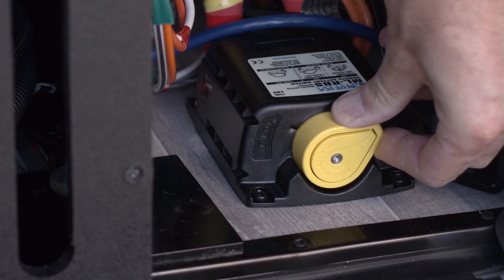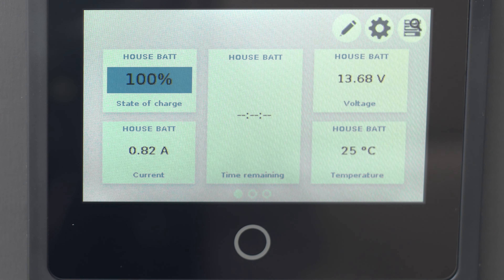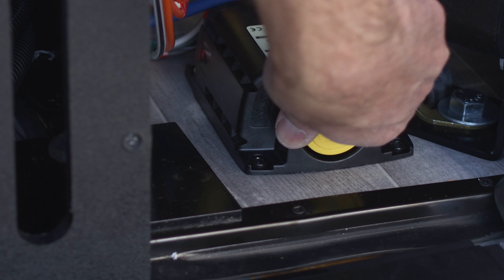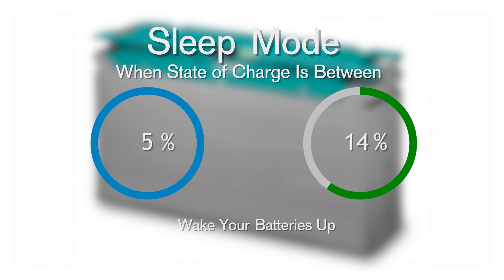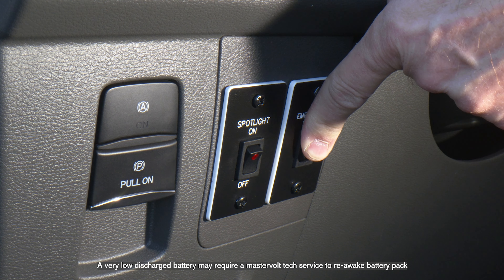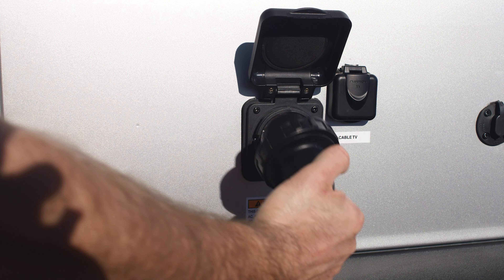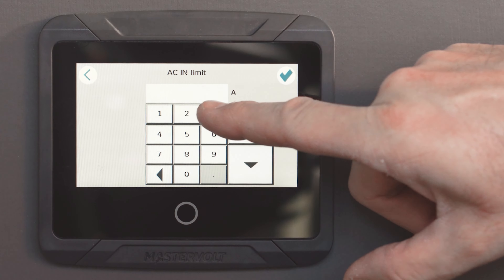No matter what you choose, you need to turn on the battery safety relay. Fire up the engine and watch that display panel — bring your state of charge back up to 100%. Then head out back and turn off that safety relay. If you forget to check on the batteries and they drop below 10 volts, or the state of charge is somewhere between 0 and 10%, they may enter sleep mode and you're going to need to wake them up. If equipped, you may need to press and hold the emergency start button for 10 to 15 seconds. You can also connect to shore power — if you are plugging in, remember to set the AC limit on your display to the proper amperage.